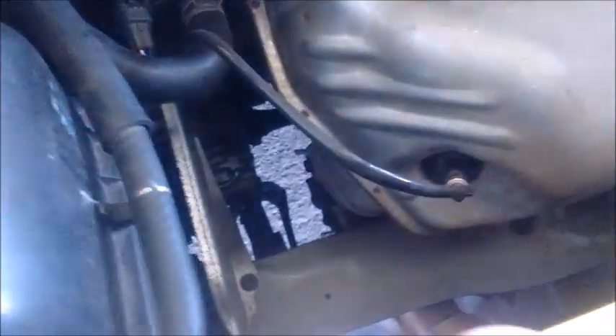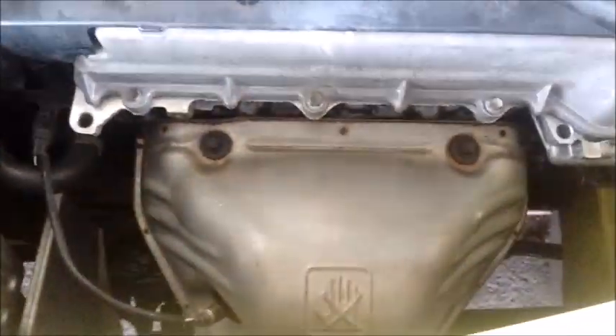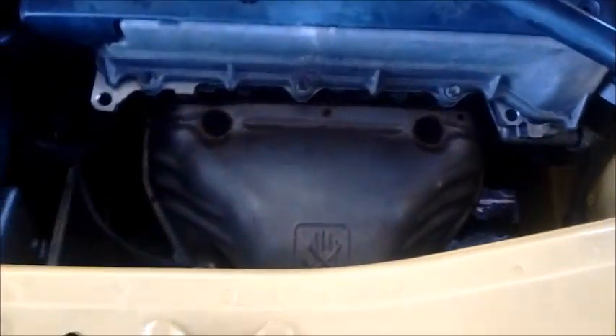You can see the matrix is nice and white and intact. So this pre-cat is okay. And we can repeat the same thing with another O2 sensor — remove it and check its pre-cat. Because just because one pre-cat is okay doesn't necessarily mean that the other is also okay. So we would remove it the same way and disconnect its connector, which is right there. And that's how we go about checking the pre-cats. Thanks for watching.